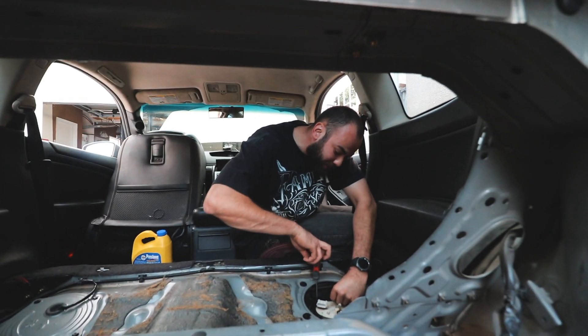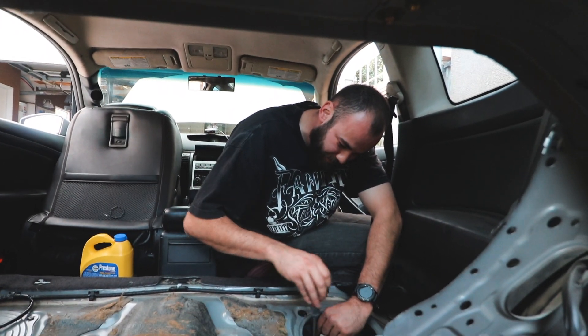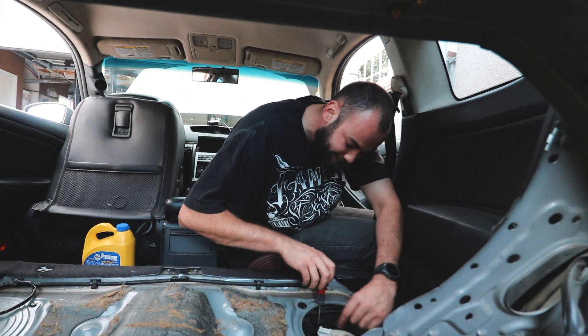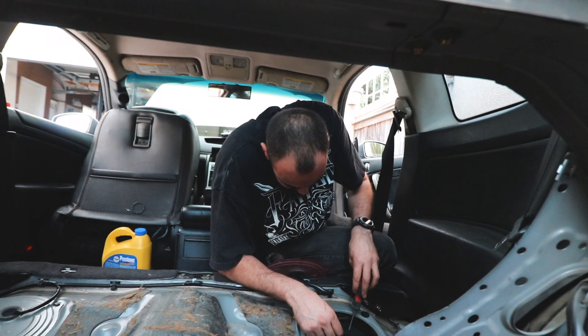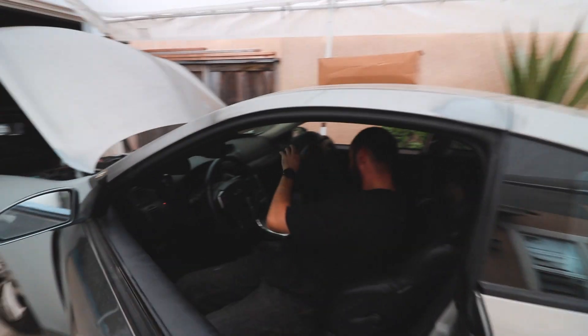Hopefully the pump is good — it should work. So that's pretty much all you have to do to get it to fit in there. Before we put the main cap on, just connect the sensor and then we'll turn it on. We didn't take out the fuse and let it die out. Now that the battery's connected, we are going to be priming it to let it build up, even though we didn't pull the fuse. Still got to prime it.